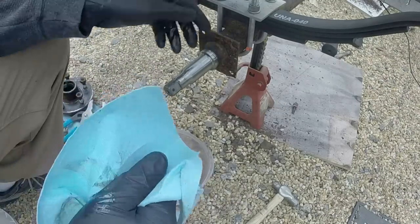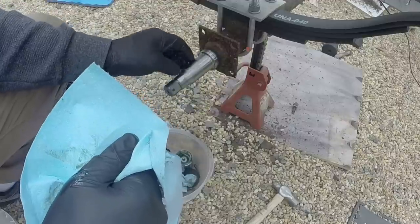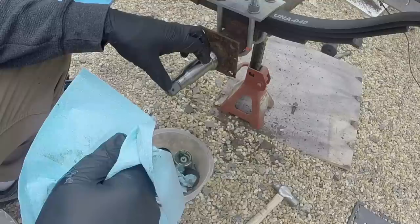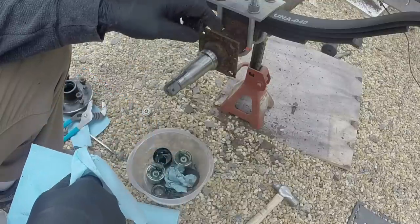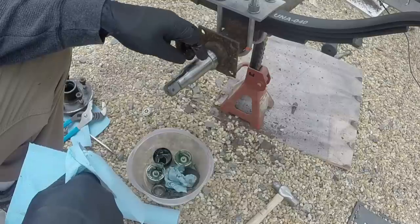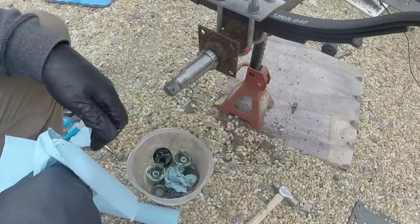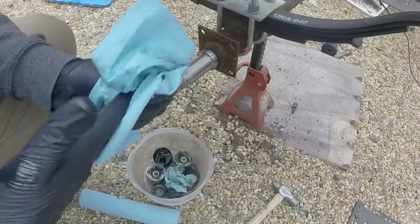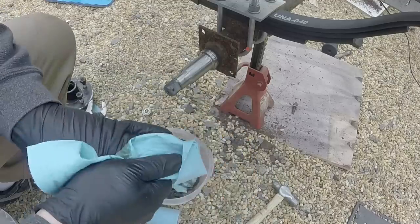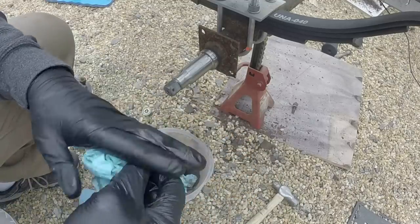And these bearings, since this is a boat trailer, the hubs can potentially go underwater launching a boat, retrieving a boat. You use marine grease. So these hubs are filled with marine wheel bearing grease. It's different than what you would put on your automobile. I suppose you could use it on your automobile, but it's designed for a marine environment. Of course, it costs five times as much.